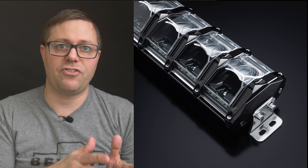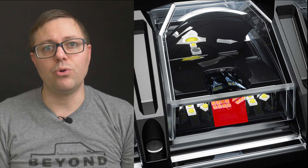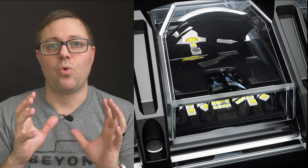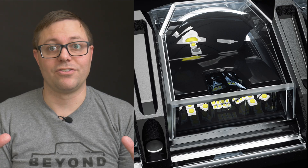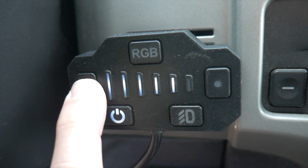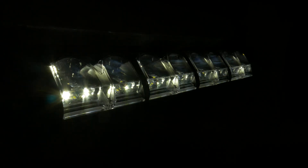Let's break this light bar down to the basics. Each light bar consists of a series of two-and-a-half-inch pods, and on each pod there are two 90-degree floodlights, two narrower driving lights, and one 10-watt bright spotlight. The controller lets you go from full flood to full spot across six steps, varying the brightness of your floodlight, driving light, and spotlight to light up the scene in different ways for off-roading. There are no moving parts and you can adjust them while driving.